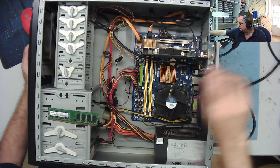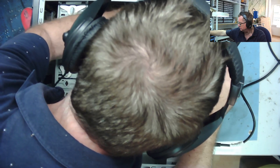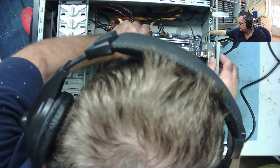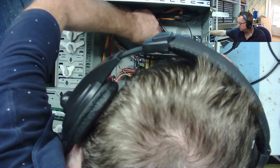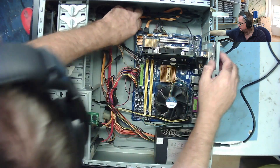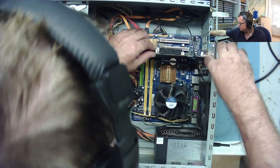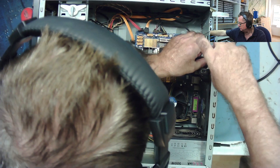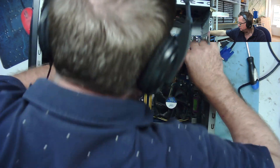Let's try disconnecting all the other connectors as well around here. We've basically just got the motherboard and processor and nothing else plugged in. Just disconnect these SATAs. So that's basically down to all the basics now - just the motherboard. We can take the graphics card out as well and see if we can get any bleeps out of this, with just the motherboard and processor. If not, we'll have to take the motherboard out and have a look to see if we can determine what's actually going on with it.